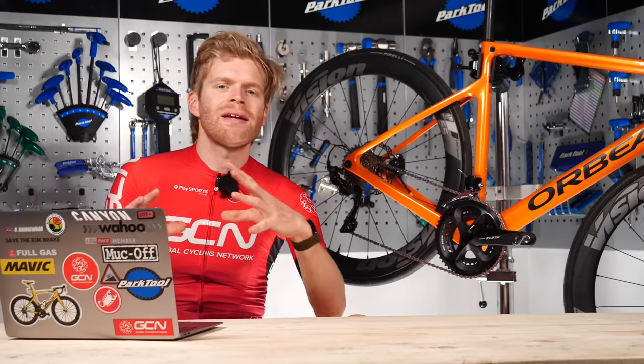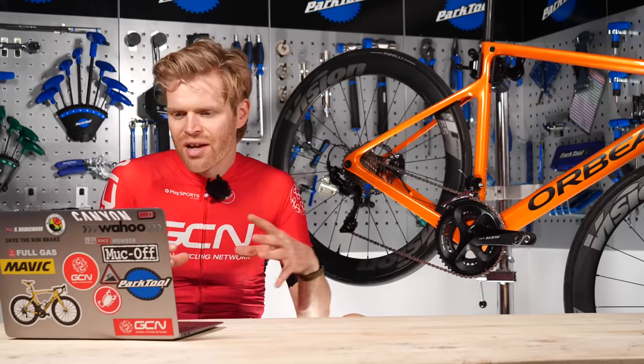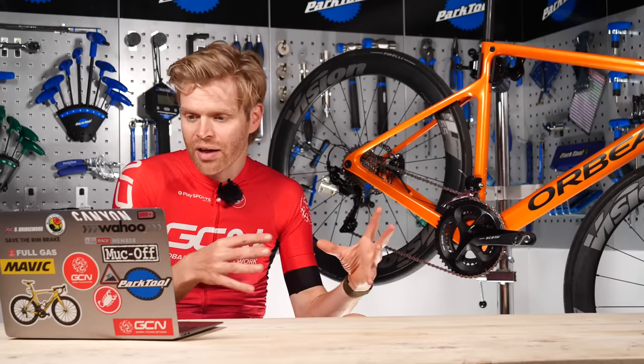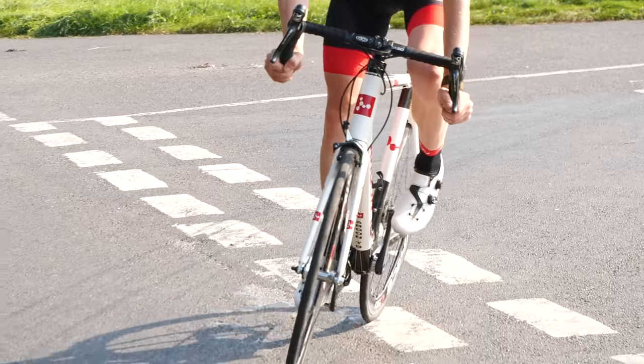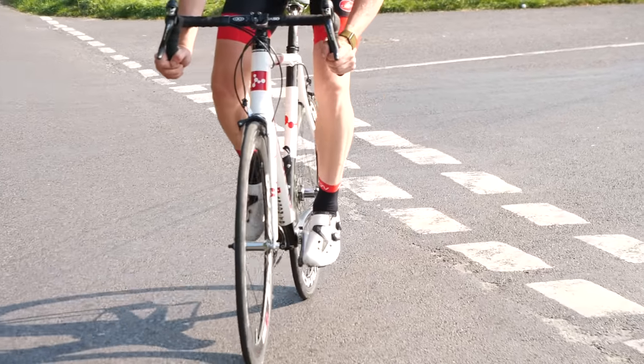Interestingly, the weight of Dura-Ace has kind of constantly been getting a little bit lighter and a little bit lighter. So Dura-Ace 7800 that precedes the 7900 we've got here, that weighed 2,181 grams without the hubs. And then when 7900 came out, that was reduced to 2,052 grams. So quite a big saving there.